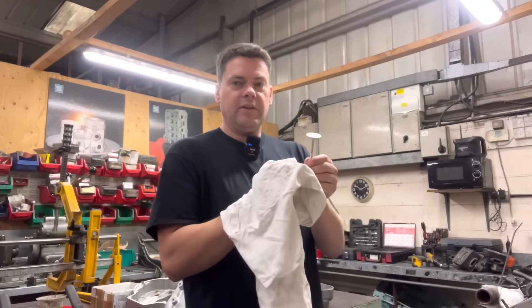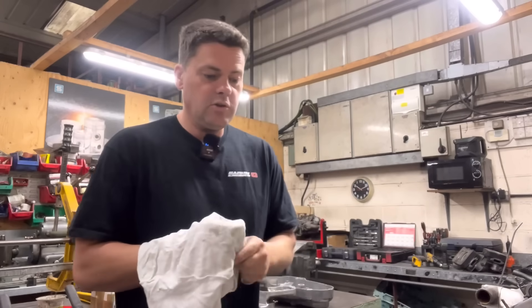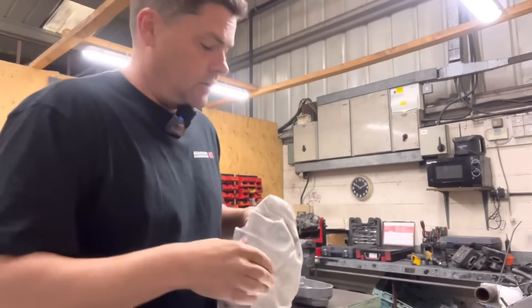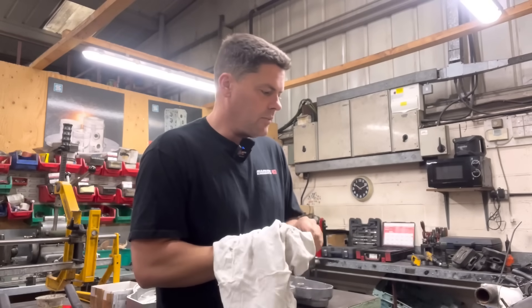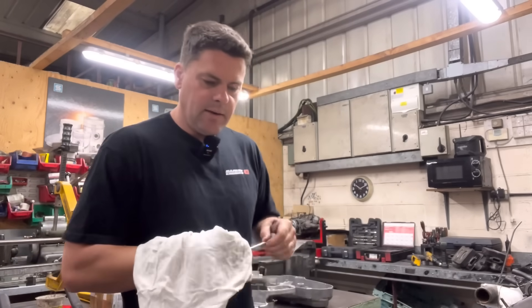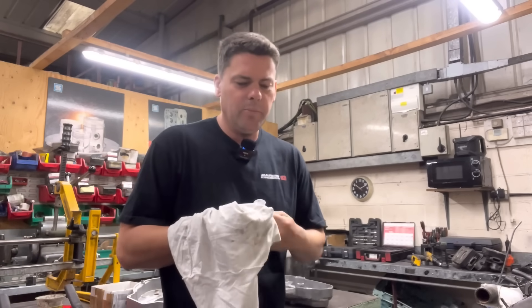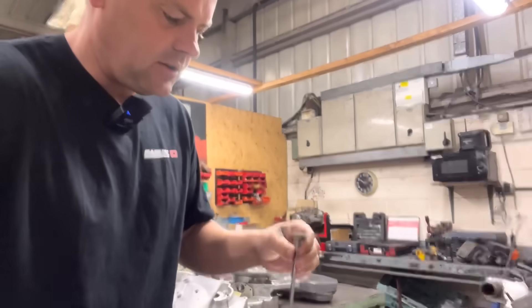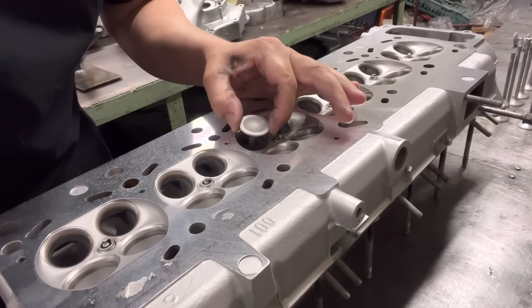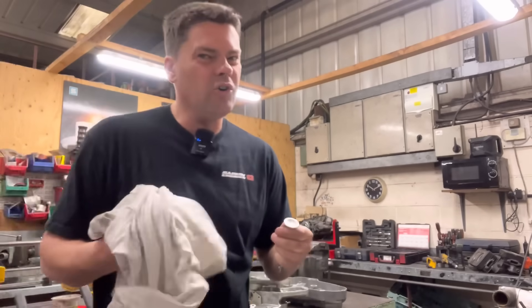What I'm going to do - I'm facing the valves at the minute. I've cleaned all these valves up, just giving them an extra clean now, laying them all out. The cylinder head is all looking spangly. I've just tried an inlet valve in the inlet guides and the same with the exhaust. The exhausts are a little bit sloppier than I'd like. If we try that down in that guide, look, you can see a tiny bit of back and forth movement. There's probably about a mil or so of movement there on the head, so not good enough.